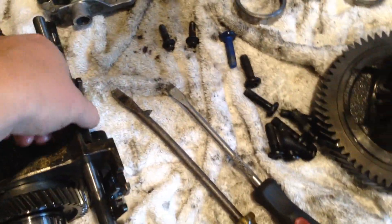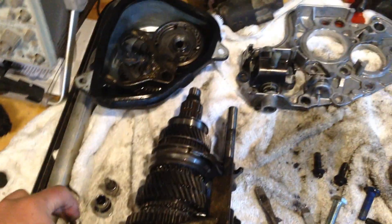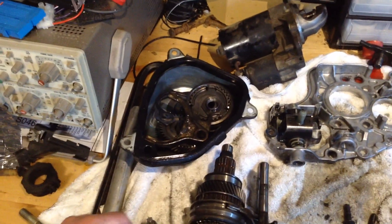There's also an M5 — that's an M4. There are two different sizes of roll pins. There's also another bolt floating around here — we've used that to tap on the heads of these. So basically we make them head to head, then you get a hammer, tap it a few times, and that just cracks the threads off a wee bit. Then you get your Torx drivers. There's a T30, a T50, and another one — I think that'll be a T40, it's between those two sizes. Ten millimeter — half inch drive — I would advise half inch drive, because some of these bolts are on mad crazy tight, so using a three-eighths drive might be a ball ache and you might end up snapping some tools.